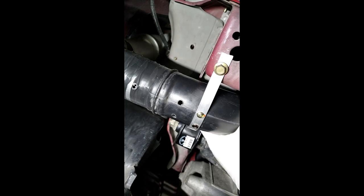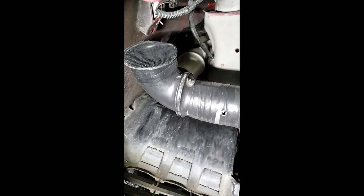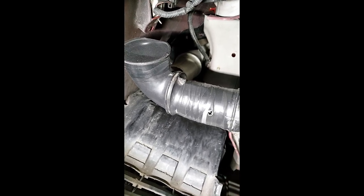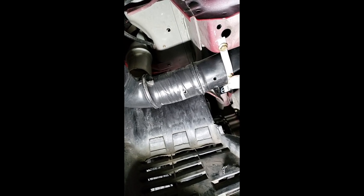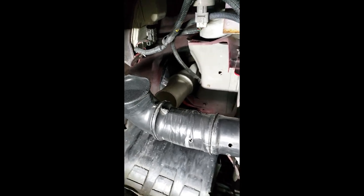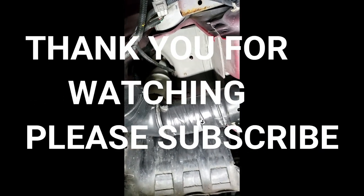This is how you customize it. It's very solid when you mount and tighten this 10-millimeter bolt — this intake is very solid. Now you get cold air coming from underneath going up. This is the best setup closest to the CT Engineer intake. If you take a closer look at their design, it's a similar idea, but you don't have to spend over $180 — you can use your stock parts. Hopefully this helped many of you, and thank you for watching.